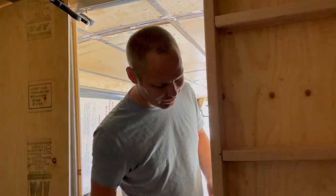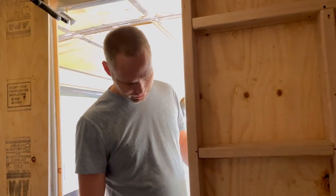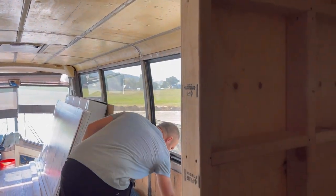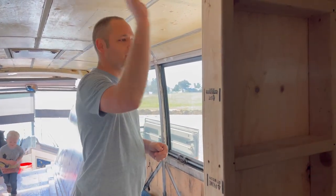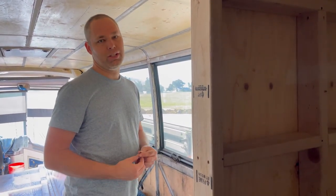My 20-year-old truck — nothing rattles, nothing vibrates. So the whole frame on the other side of this was glued together with just some liquid nails to hold it together. And now we're putting in a bunch of screws. I'm countersinking all the heads on the screws so that we can skim this plywood later on, sand it, and then we'll have a nice smooth surface for painting.